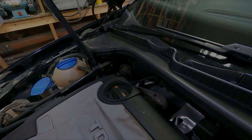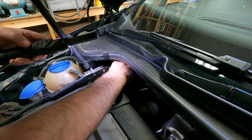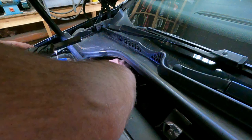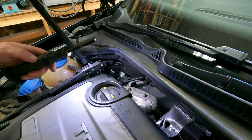Okay, so once you've finished and you're happy, the brakes are bled and your brake fluid level is topped up, don't forget to put the cap back on. Nip it up. I have spilled some brake fluid here. It's a little bit difficult not to spill it down in here. So once that's all nice and tight, just grab a small bottle of water. Give it a little rinse off, and that can drip on my head when I'm changing the oil.